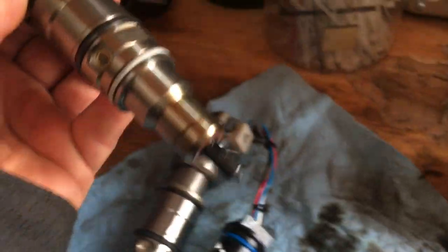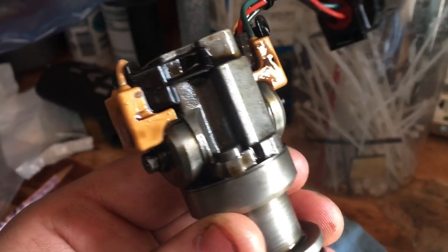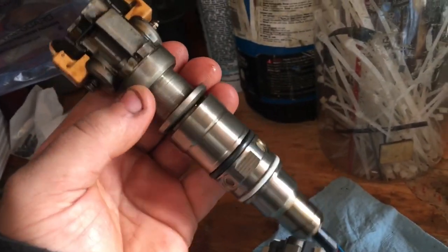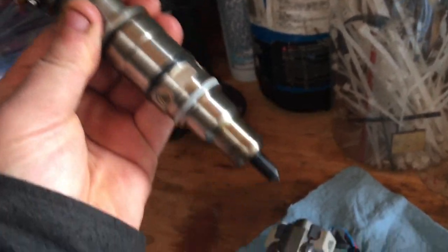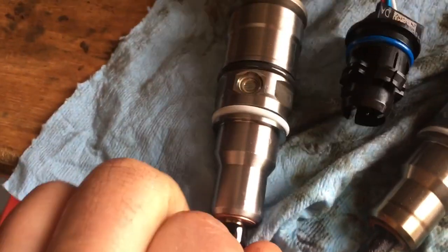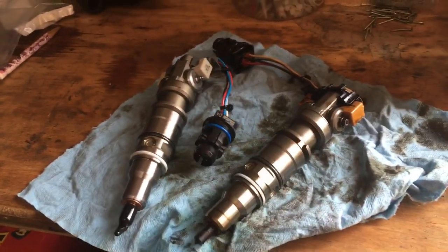Here's our old one. Everything was sealing fine — my guess is just wear and tear. I'm thinking maybe in the next video we might tear this injector apart and see if there was maybe some stiction going on, since it seemed to act more when it was cold than when it was warmed up — then it would just smoke when warmed up. This new injector is looking all pretty. No assembly required on these; you don't have to put any o-rings on or anything like that. Just take your rubber nipple off, and then we're going to oil each one of these o-rings — the two here and that one there — and then we'll get our injector hold-down around this and get it in.